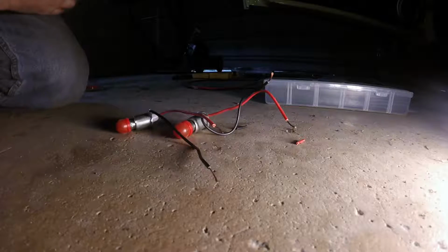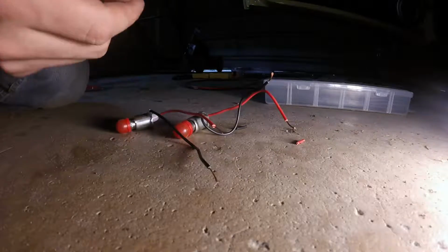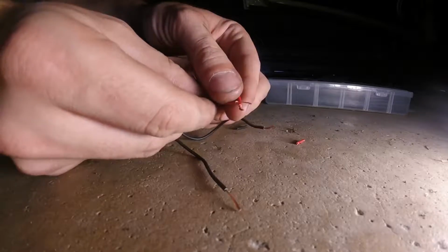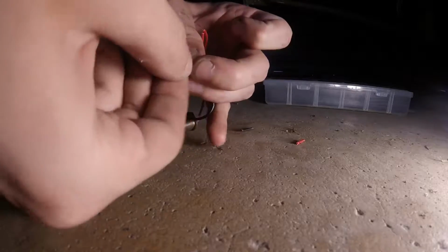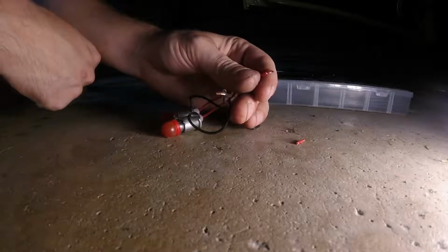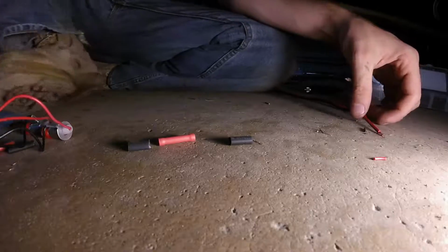Now, because the gauges I installed are 2 gauges in one cluster here, and I've got 2 backlights to install, I'm going to take the matching wires from each of these lights, and I'm just going to be connecting these together. They're all going to run at the same time. So I'm simply going to strip these wires back, and then just twist them together, so that on my next connection, I'm working with essentially just a single wire each. Now, this first method couldn't really get much easier.